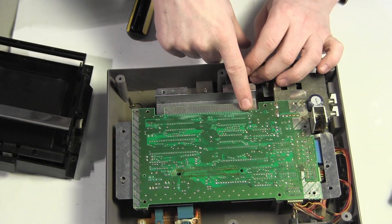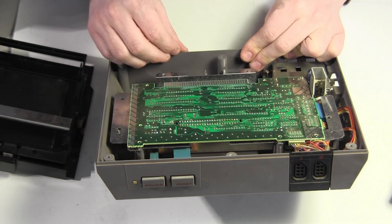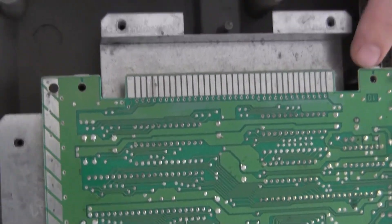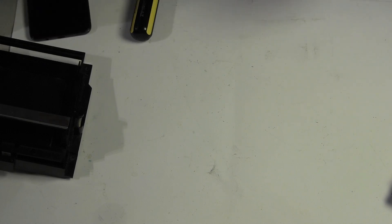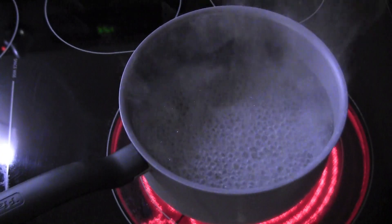While the 72-pin connector is off, you're going to want to take a little bit of metal polish or rubbing alcohol and a Q-tip and just run it back and forth on these teeth to clean them up and make sure you have a good connection. These don't normally corrode, and it actually looks like somebody's maybe cleaned this and almost sanded it — you can see it on the motherboard, so this one might be no good regardless. It felt kind of tight when I put a cartridge in, which tells me the pin connectors were probably replaced with a cheap Chinese one, which you don't want to do because they're prone to failure and they never work when you do the boil trick. Only buy one of those if all else fails and you can't save the old one.